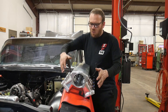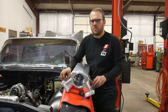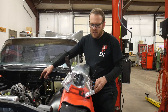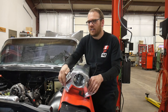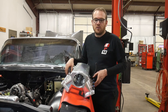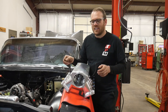I want to prepare this intake manifold for installation. I don't know if the fuel rails would be better to be installed now or once I get it on the vehicle. I think if I install them on the vehicle it'll be a little more difficult to get to the mounting brackets for the fuel rails, but at the same time it'll be harder to get to the intake hold-down bolts if the fuel rails are in place. So I might try mounting them loosely on here, get it in there, and then snug everything up once I get it where I need to.